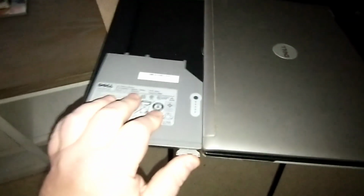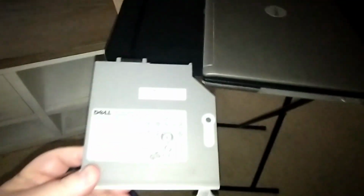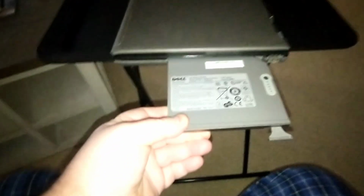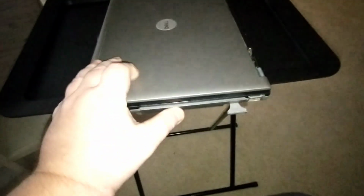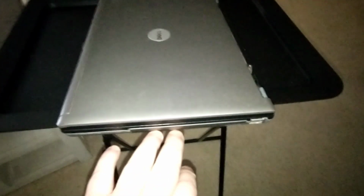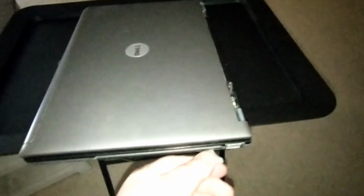And he's asking me where this is the battery though. This is the extra battery here. Okay, you pulled your DVD-ROM out. Now you take your extra battery that you bought, your secondary battery. Just push it in. Okay, and push your tab in here. That locks it in. But it's the same way for replacing your DVD-ROM, CD-ROM. It's got a little lever right here. Just pop it out.